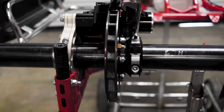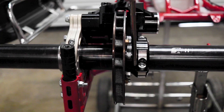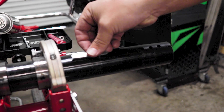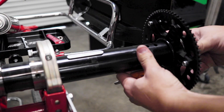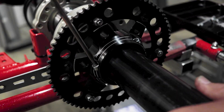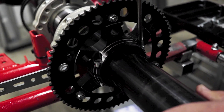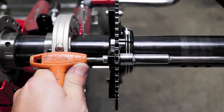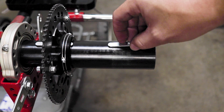After the set screws are in, center up the brake rotor in between the pads and tighten that down. Make sure you tighten up the bolts on the brake hub as well. Then use your parts wash to clean all the WD-40 off the brake rotor so that you don't go on track and have a slippery issue — that's a big no-no. After the brake hub and axle are in, put on the sprocket hub and the sprocket and line it up. You can use a laser liner or a straight edge to make sure the sprocket is lined up for proper wear. Then put the keys and rear hub on, set your rear width, tighten everything down, and throw your wheels on.